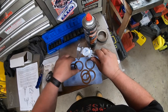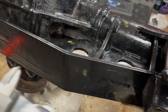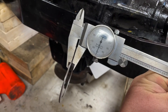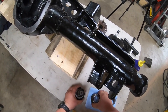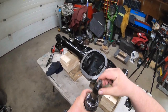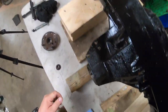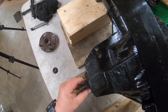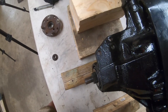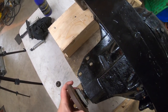Right now what you see is I'm using a pinion depth measuring tool. There's a mathematical calculation you gotta figure out to get your pinion depth — it kind of gives you a starting point. You put all your shims on, and you can see what I mean by a setup bearing — it just goes in. We don't use a crush sleeve at this time; we just set the pinion up and measure the bearing preload according to the specs for used bearings.